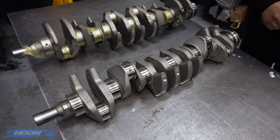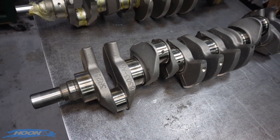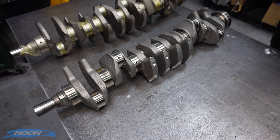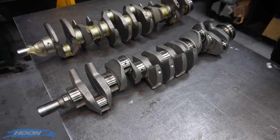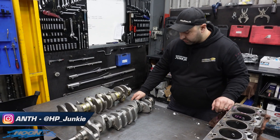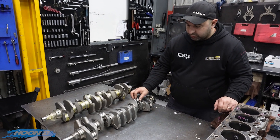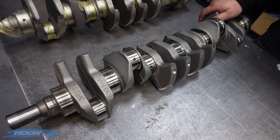We could be using this crank - and like in the past you and I discussed the heat treating of cranks and stuff like that. What's the advantage of heat treating that crank if we did stick with a standard one? Well, basically once we put a very hard skin on this crank, what it does is it promotes better oil flow on the bearings, it prevents the bearing from galling on the pin, and it allows the wear resistance of the crank to be much higher.